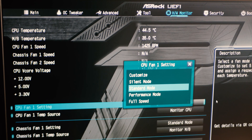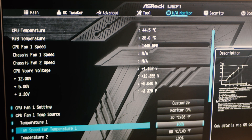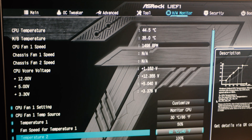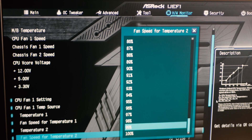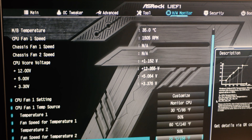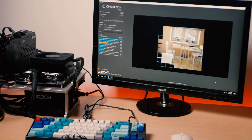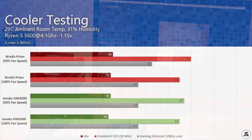For today's testing, our test setup consists of two scenarios under two fan speed settings. I went with fan speed as opposed to a normalized noise level to also compare noise levels between various coolers at either 50% or 100% fan speed. Our first test scenario is on a manually clocked Ryzen 5 5600 running at 4.1GHz at 1.15V. Based on our testing, the HX6200D is pretty much neck and neck with AMD's Wraith Prism at 100% fan speed, but beats it slightly when running on a quieter setup.